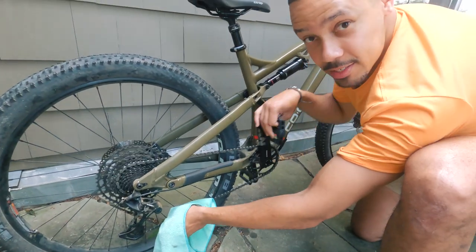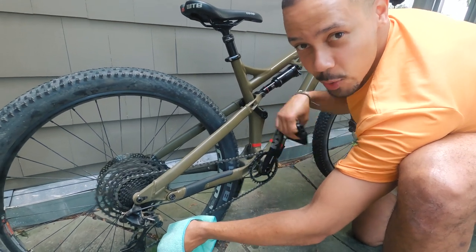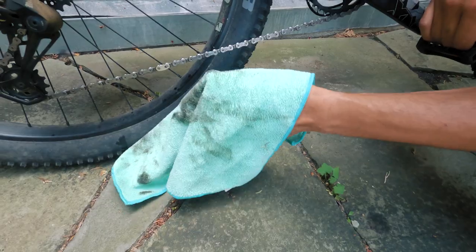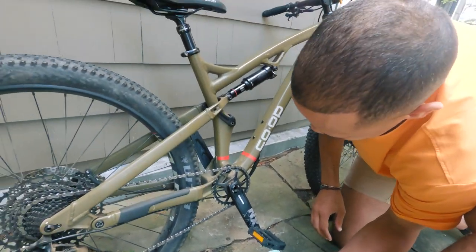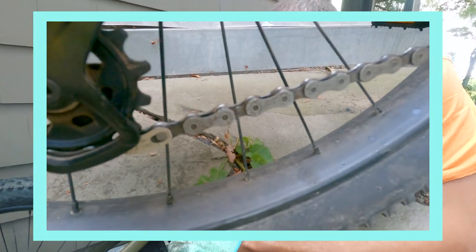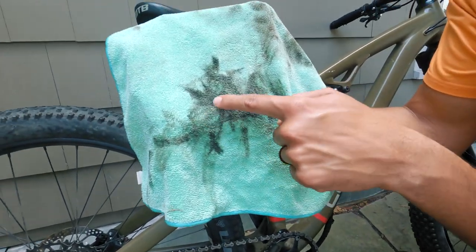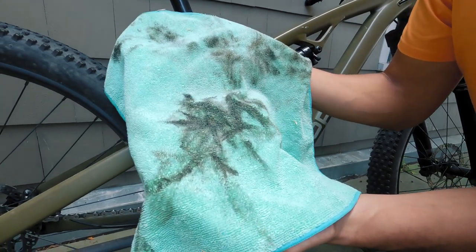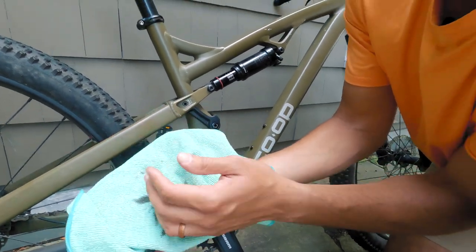There is no limit to how much you could do this. You could sit here and do this for 20 minutes and you're not overdoing anything, because whatever lube needed to get where it needed to go is already in there — so you're just taking off excess. The chain looks new — it's like silver again. If you noticed before, there were some rust spots on it. As long as it's not too rusty, just adding some lube and wiping off the excess will bring all the rust onto the rag. You'll actually take off some of that rust that builds up on it.